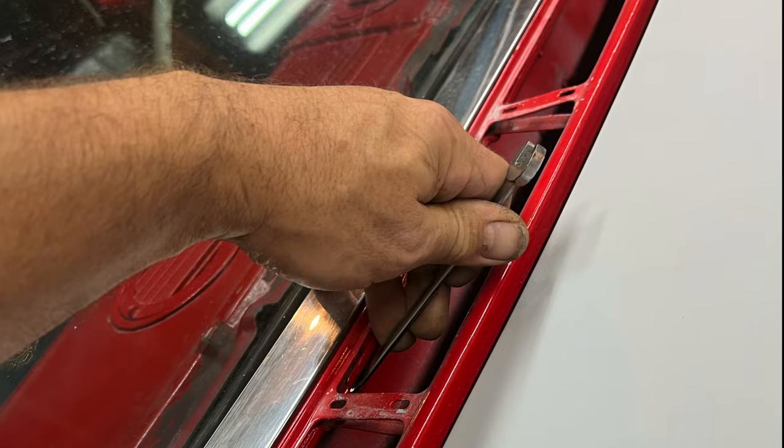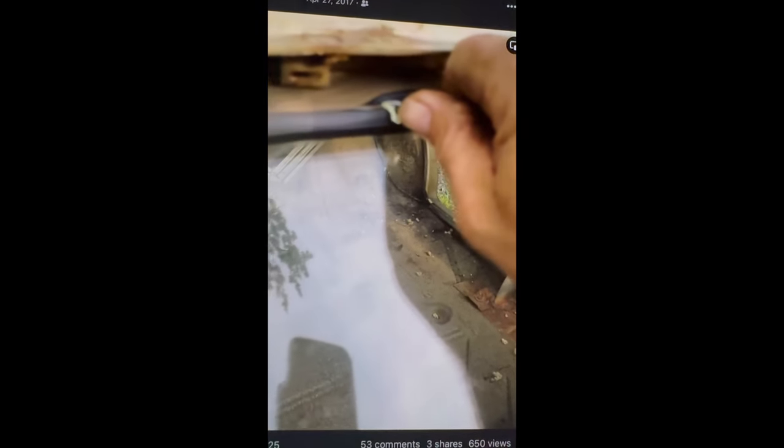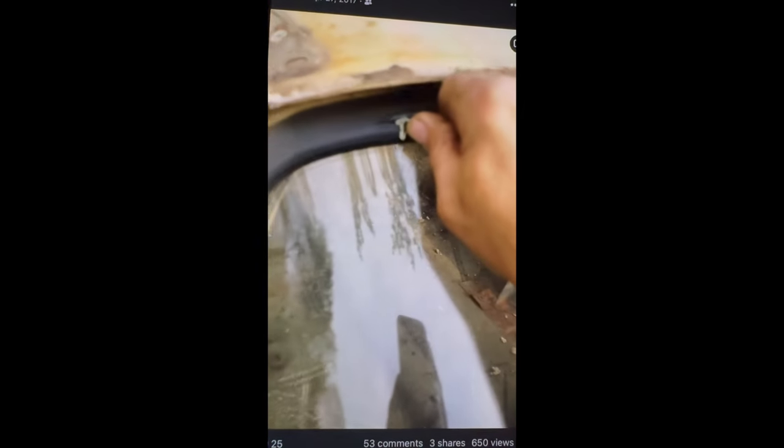To release the lower windshield trim, you'll have to access three 3/8 nuts through the cowl screen area. These are usually overlooked, but must be removed to properly remove the lower stainless. This gasket was exceptionally pliable, and if you're lucky, you'll encounter one just as soft. To release it, you'll want to use a nylon tool or a blunt screwdriver to separate the inner and outer locking strips. Once the entire perimeter is unlocked, you can fold the glass edge lip inside itself, basically gasket inside rear half. And at that point, you can start working the glass out of the channel of the gasket itself.